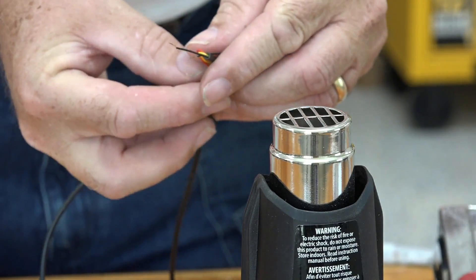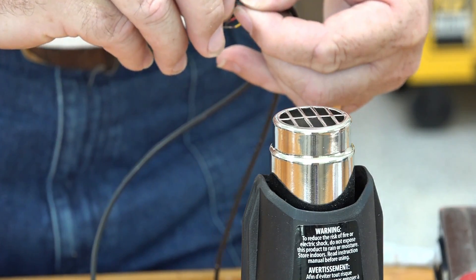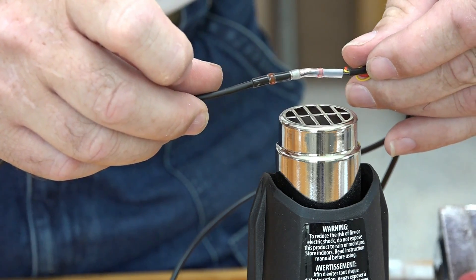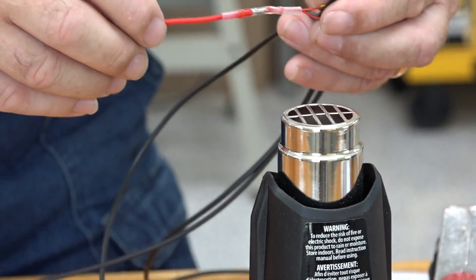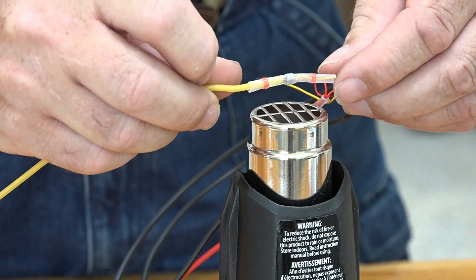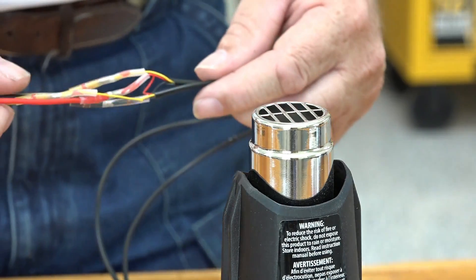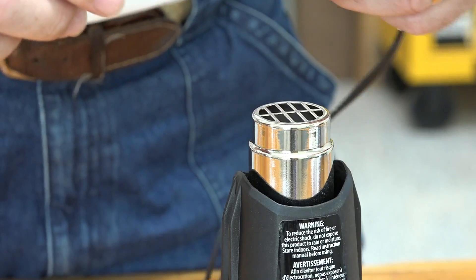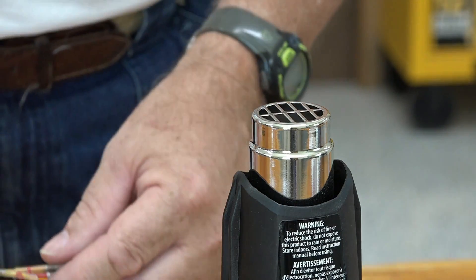For the first test I'm going to put together two black wires. Here's the red wires all going together. There are all four wires soldered. Now I think I'll actually put a heat shrink over the entire thing, just as a precaution — after I go and test it.